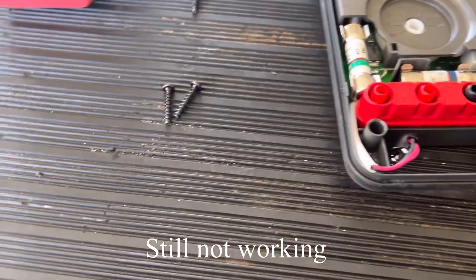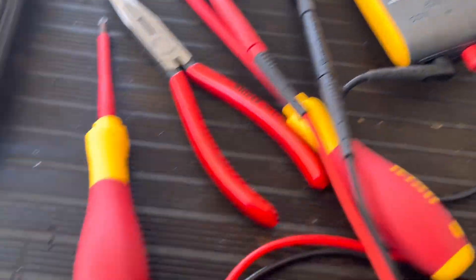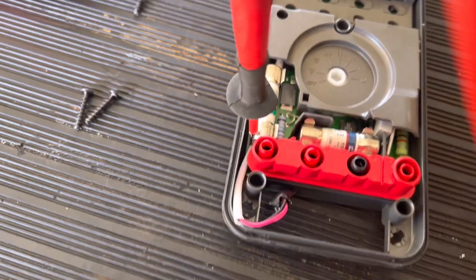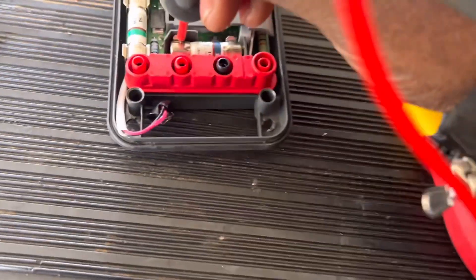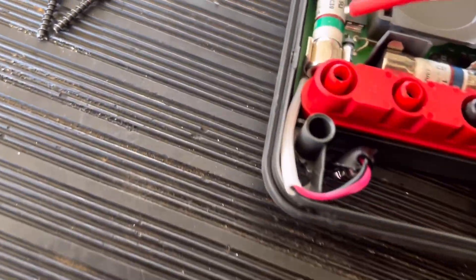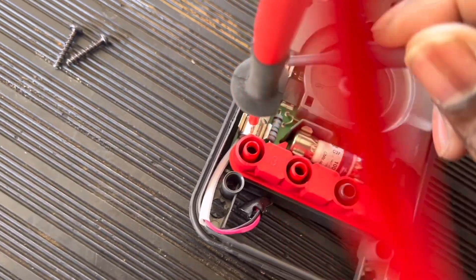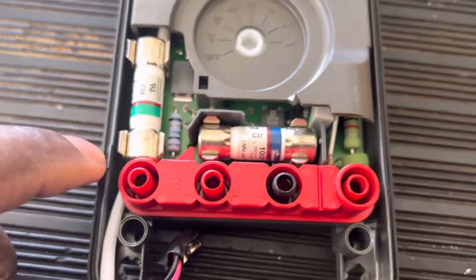Something was definitely wrong when I couldn't read current on the amperage scale. I pulled out my meter so I can test the fuses — something I probably should have done when I first got the meter. I never use this meter for amperage testing because I always use the amp clamp. This fuse is good, but this fuse is not good. I think this is the one from my 10 amp. So I just opened up my Fluke 87 — it should have been able to accurately measure the parasitic draw, but it's got a blown fuse in here.